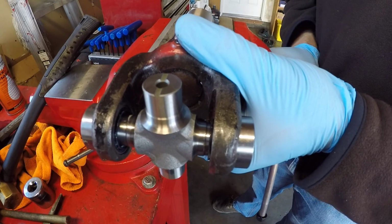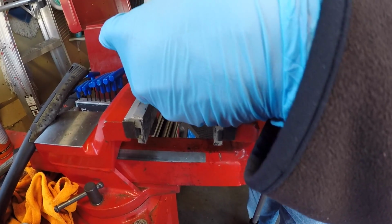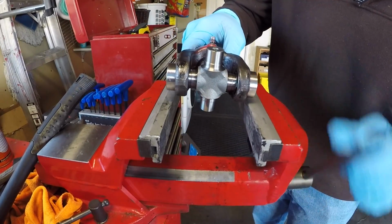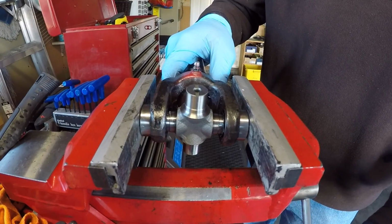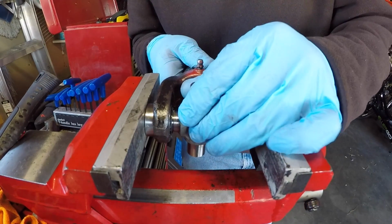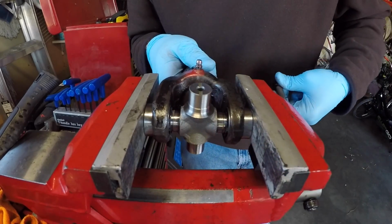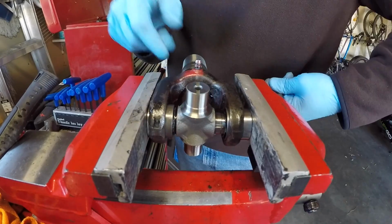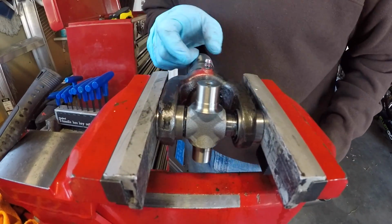Now we're going to use our vise to basically press these two together. Whoop, make sure this guy stays in the middle, keeping our needle bearings aligned. We're just going to use the vise as a technique to get these started. And as I proceed, I'm going to make sure that this thing still turns smoothly and slides a little bit in and out. One is preferring the other. Now this has bottomed against the yoke, so we can keep going, and now this side's going to press in.